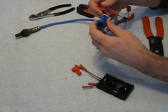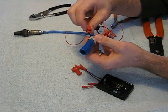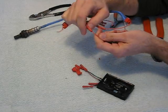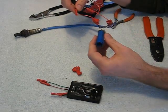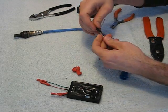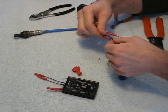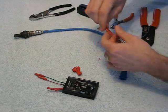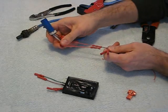Then you'd go back and do the same thing for the wire attached to the plug. As you can see here, I've already attached one of the crimp connectors. You'd crimp it on and take that wire — it leads back to the output from the O2 sensor enhancer. So the output goes to the wire attached to the plug. Same deal: put it into the crimp connector as far as it can go, crimp it, and the connection has been made. The connections are now made to your sensor and to your enhancer.